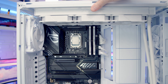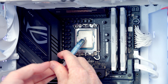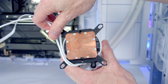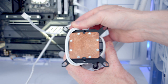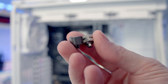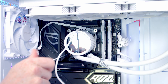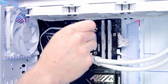Push the bracket in briefly while we install the pump. If the AIO is new there'll be thermal paste pre-applied; since this one has been used before add some thermal paste to the centre of the CPU. Wrap the tubes from the AIO up around the bracket to keep them out of the way and organized towards the top of the motherboard. Insert the pump over the bracket, use the thumb screw with the line in the middle, get a thumb screw onto each corner and tighten each one up.